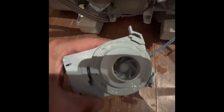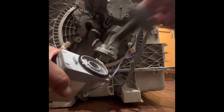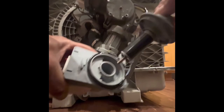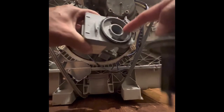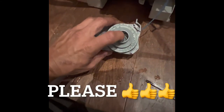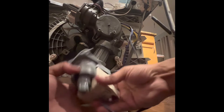After I cleaned that out, I hooked it back up and boom — it starts working. This is for people that are having problems with no spray. You can pull this right apart like this — it's just a magnet that holds it. But this isn't the problem; none of this, you don't even have to take it apart. I cleaned in here, I cleaned all this stuff in here, but it didn't need to be cleaned. The problem, once again, was right in here. There's all kinds of gunk that gets stuck in here — that's where you need to clean. Once you clean it, then you put it back on. It's a little tricky to put it back on, but don't fret, don't stress — you'll get it back on.